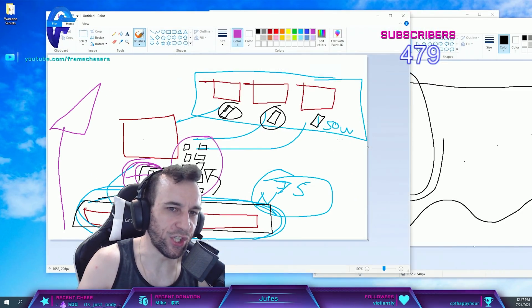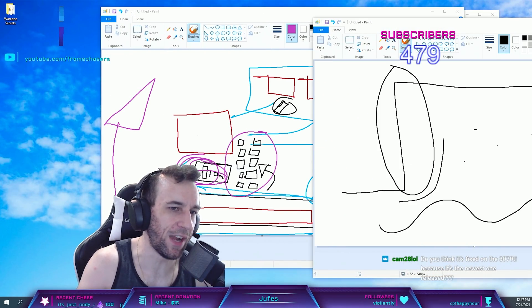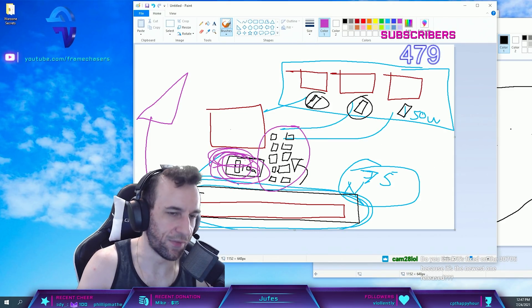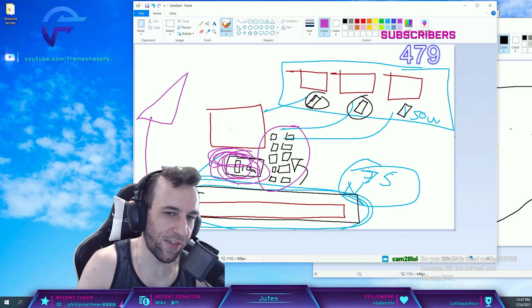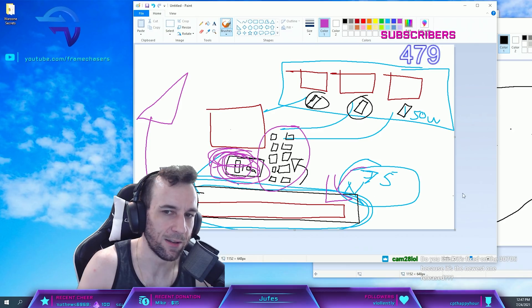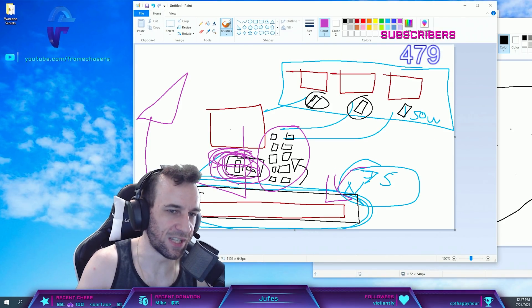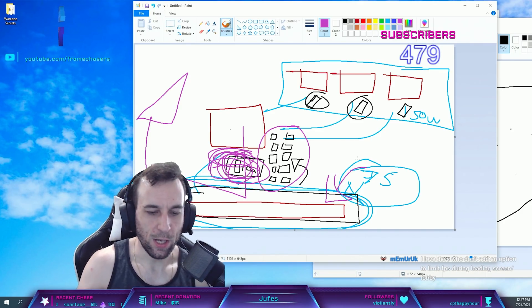That's pretty much why EVGA cards specifically were all over the headlines — because no other manufacturer has this specific problem of a 10 amp fuse combined with an improperly balanced PCIe slot. You hit a loading screen and it blows the fuse right off the bat — your card is gone.